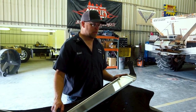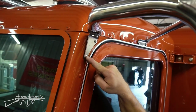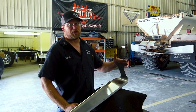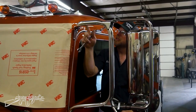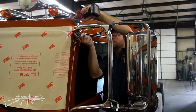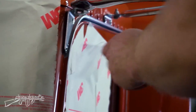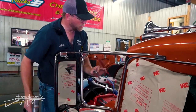The visor mounts into two holes on each side of the cab, but the upper mirror brackets are currently hucked into those holes. The mirror post bolt is removed first, then a grinder is used to take the huck bolt heads down to a low profile before drilling them out the rest of the way. Since hucks are very hard, grinding as much as possible minimizes drilling. With the bracket removed, a protective plastic piece is also taken off.